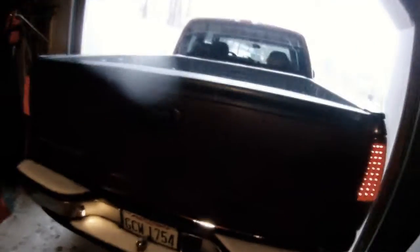I just turned the truck on. So if we come under here and take a look, this LED light is not on. Let me get this light away from it and see if that changes anything. It's here in the dark. Nope, that light is still not on. And if we take a look over here, this one is on. So to me, that indicates that the LED light is not compatible.